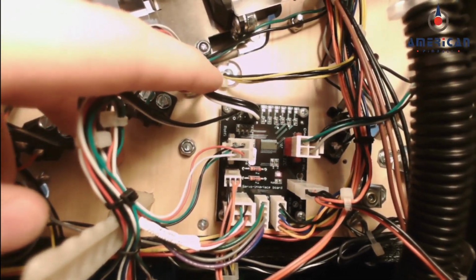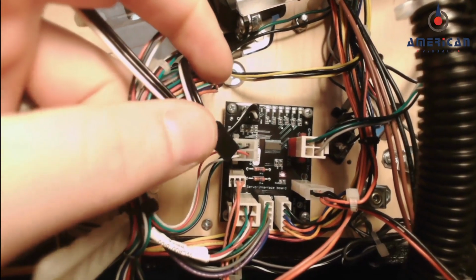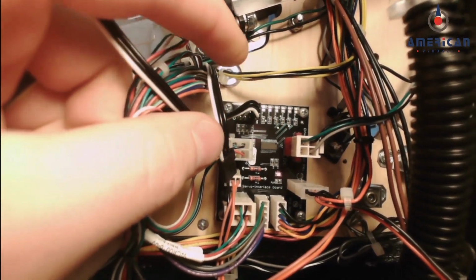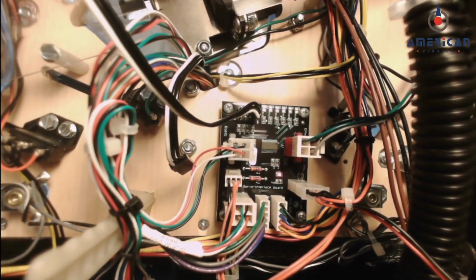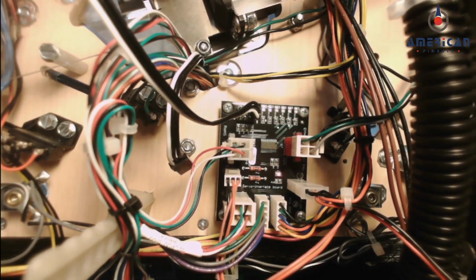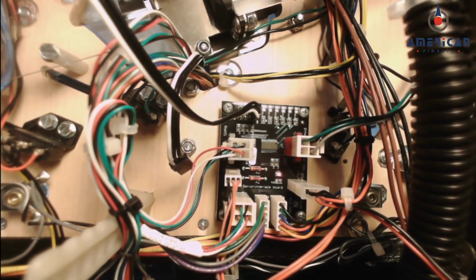So if it's not moving, what you can do is unplug the 0 position servo and move the captive ball from the 1 position to the 0 position. What we're trying to do is eliminate the possibility of the servo interface board being at fault. So now you will go through the same process of running through the tests, and you want to see if the servo for the captive ball now moves with the functions of the curtain opening and closing.